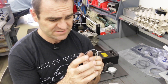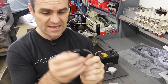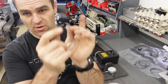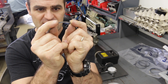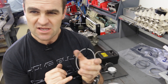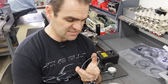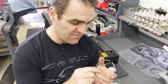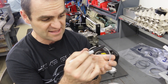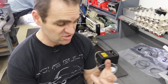That's one gap done. All I was doing is going through making sure I'm getting it square on the edge of the ring — the way to test that is to bring the sides in, make them touch, and make sure they're touching square. Another little trick Neil showed me: you only take the edge off one side so you keep it even. A way to remember that is he puts a little texture mark on one edge of the ring so you know which side is up, in case you forget which side you started grinding on.